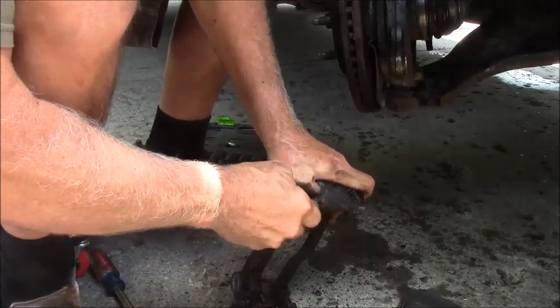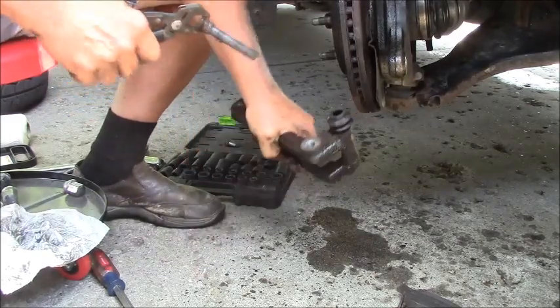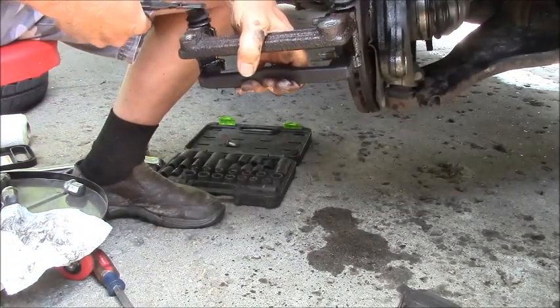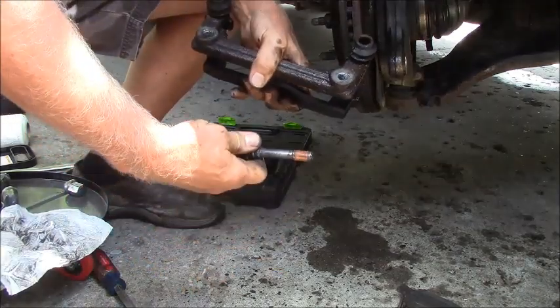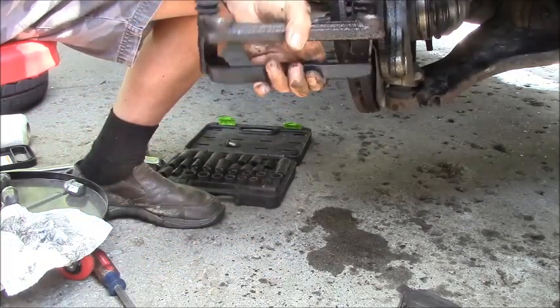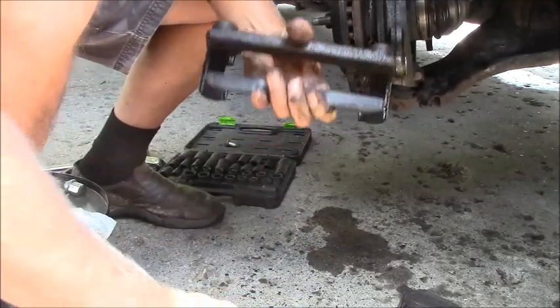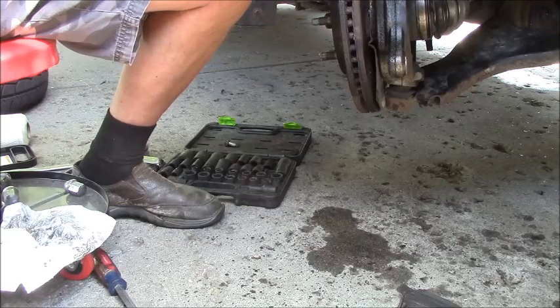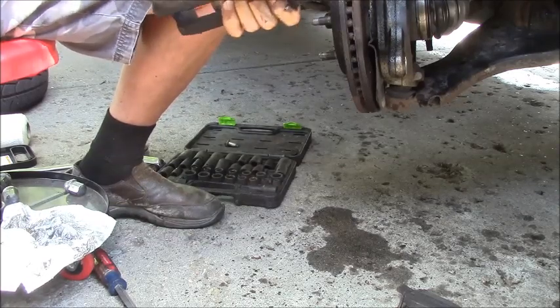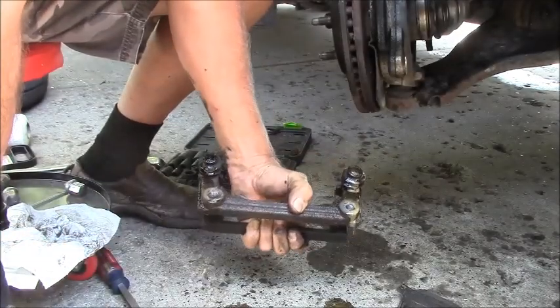I'm going to pull that pin out. Oh my goodness, that is stuck. I think I've got to go get a tool. I've got brake caliper lube here. I'm going to flush this out - the upper pin and the lower. I'll use PB Blaster - just to have a solvent in there of some sort. I don't know if there's any better way to do it. The boots are in fine shape - nice and rubbery.